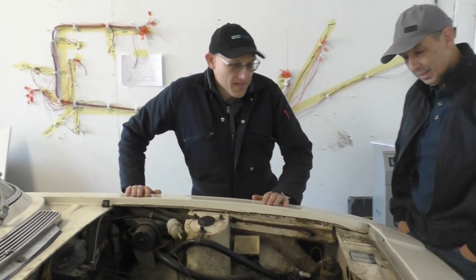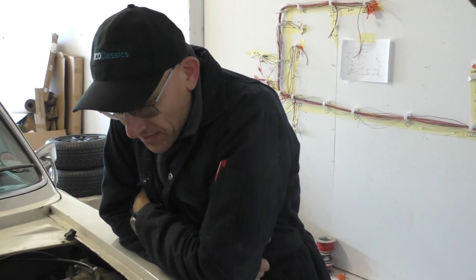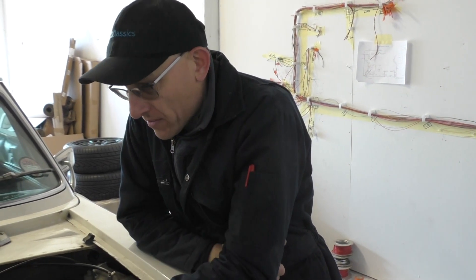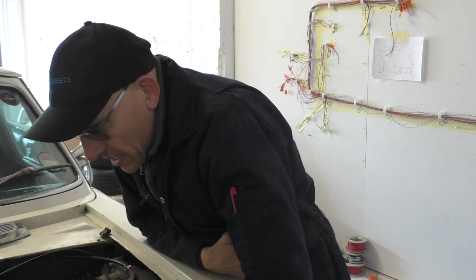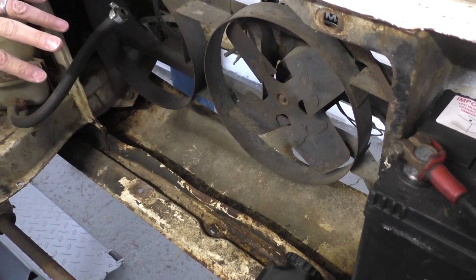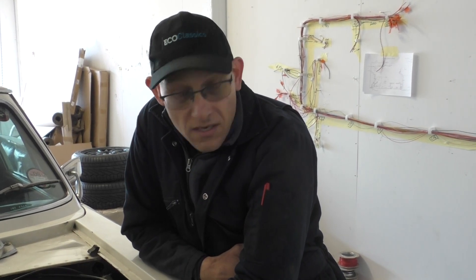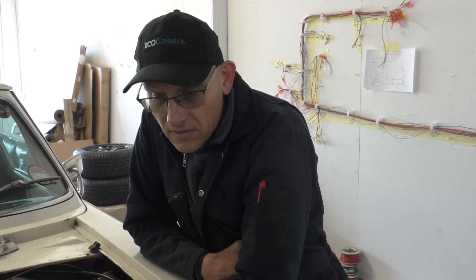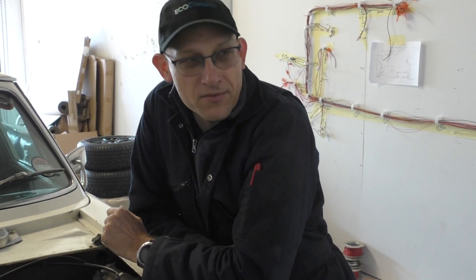Up front it's a little bit dirty — we'll spend a little bit of time scrubbing that down, but no problem. It's still got quite a bit of the original car in here: power steering pump, AC system, all the old wiring looms. We seem to have lost one of the fans, but I've got the old fan sitting in the garage at home. This gives us the package space — we've taken a lot of the dimensions off this and shared them with a partner we're working with to design the battery. We're using the LG Chem batteries, and somebody outside has the CAD for that, so we've given them all the dimensions and mocked up a plywood battery — because we love doing that.